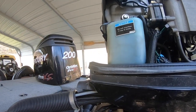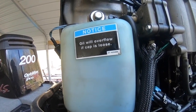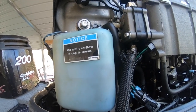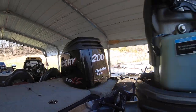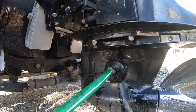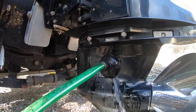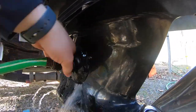There's your oil reservoir — it clearly says 'oil will overflow if cap is loose.' That's what we want: we want to bleed through and get oil up into the tank. We've taken off the hood and got the motor exposed. You will need a set of earmuffs so you can get water to the motor, and you'll also need a hose and a water source.